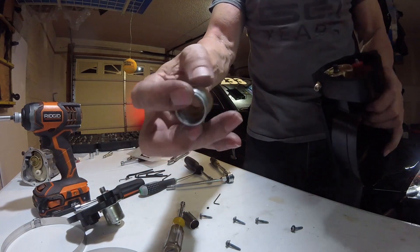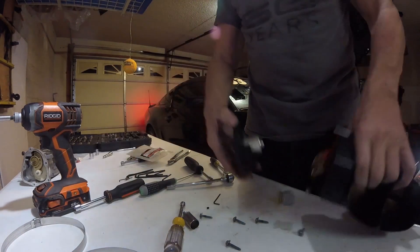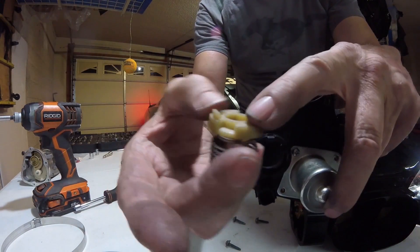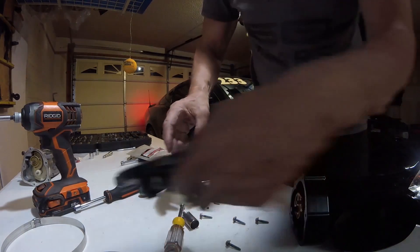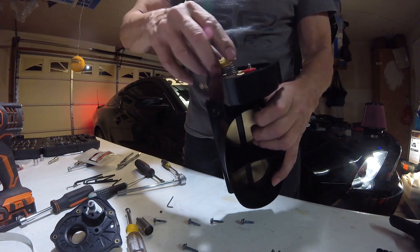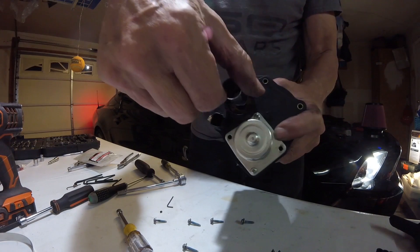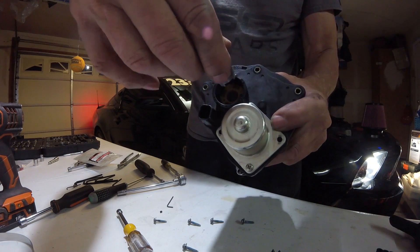Now when you're going to make the adjustment, you'll see there's a small hole and a large hole that match the small and the large tang. You can see that from the side profile — the small one and the large one are going to pop into those two holes. Once you rotate it counterclockwise, I'll show you how that's done. Take that, set it in the hole, drop it on so the bolts are all aligned. This spanner tool is going to help you grab it — push down, rotate it counterclockwise, then let it back slowly and it'll pop right into place.